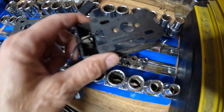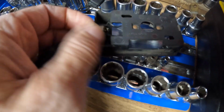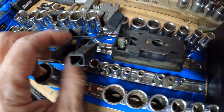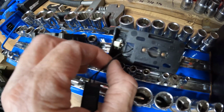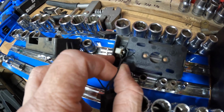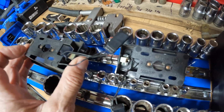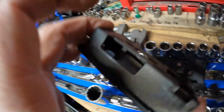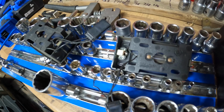Right, so first of all, check out the Austin Rover logos on these. That's pretty cool and retro. But there are 3 wires on each of these courtesy lights from the tailgate, and they've both lost 1 or 2 solder contacts, so I just need to re-solder these things up, and then I can hopefully have nicely functioning courtesy lights in the boot. I can replace these with little LEDs as well to make it a bit more power efficient and brighter. A little side job really there.